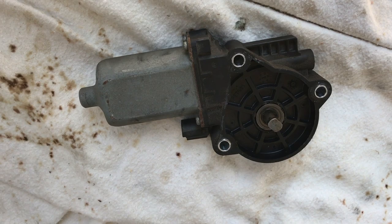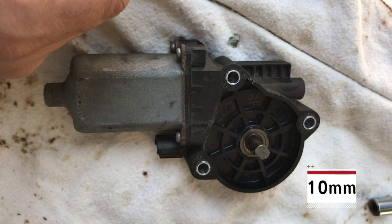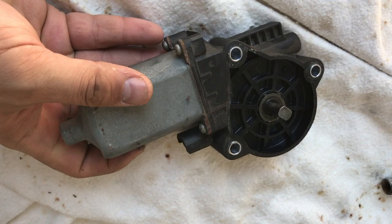It's just those three bolts. For those of you who are changing it, it's a 10 millimeter bolt. And so you just pull those three off and then this puppy falls right off. There's a wire harness that clips into there, and it was just to push down on the clip and pull it out. Super easy, took about a minute.